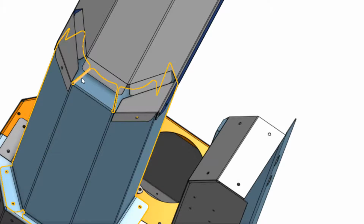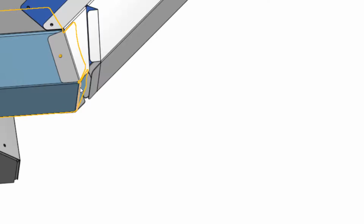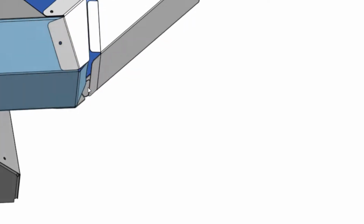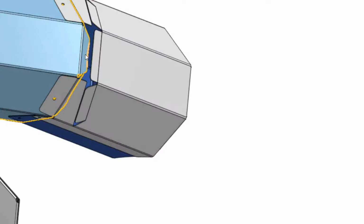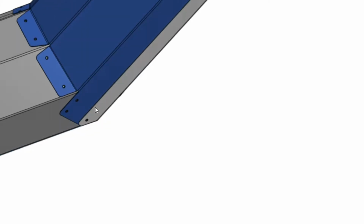There are 3 flanges on the end of this that will bend up, to get inside of a support bracket that sticks up here and holds the exhaust pipe rigidly in place. So you bend those up, and this piece will slide up from the bottom. I've got them bent a little bit here, but you can bend them more if necessary. You can also trim them if you have to, but the idea is to have some flexibility in pushing them up against that support to seal it or reduce the gap around it.